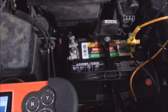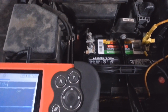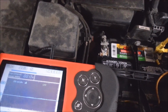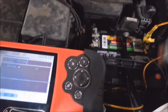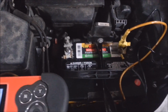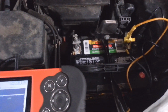You go to parts stores, you go to battery stores, you do it in your backyard, and a lot of people just slap them in. It's so stupid. You get some baking soda and water, make a solution in a cup, take the battery out, and soak the terminal ends. You don't even have to take the wires off. You just soak them until they stop bubbling, because it makes a chemical reaction that gets rid of all the corrosion. Clean the terminals real good and put them back on.